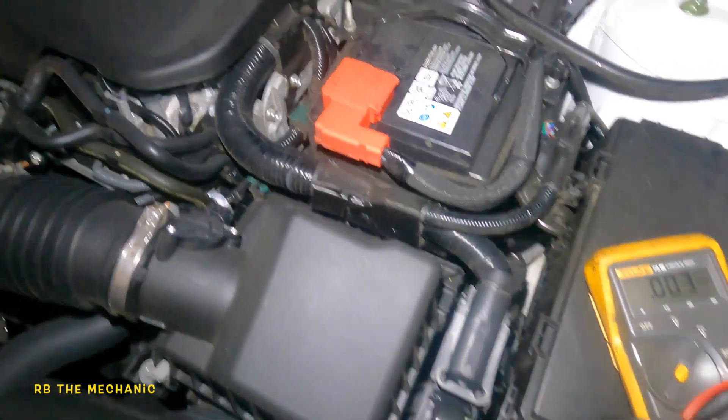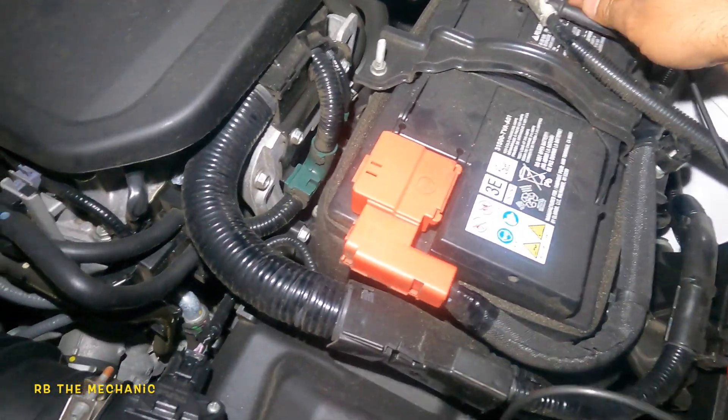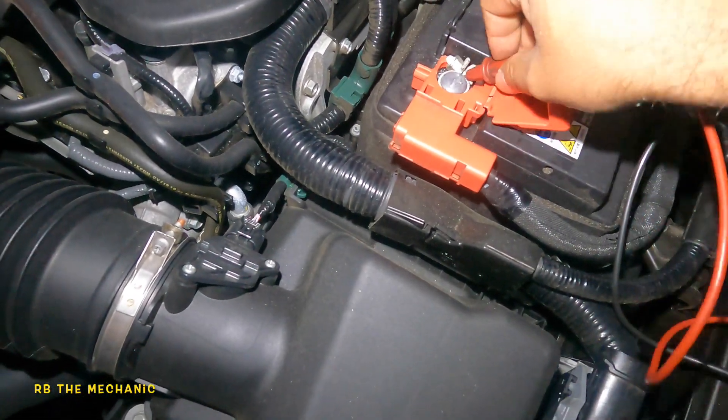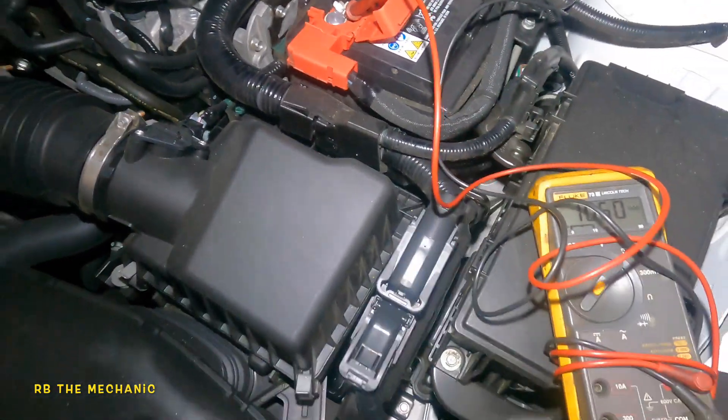I got this on my DC voltage here, we're gonna plug this right here. Okay, that's a good spot. We're gonna pop this open — we had a voltage drop on the alternator. Right now we got 10 volts here. Guys, start the car.